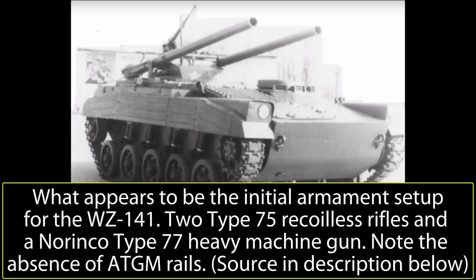A large access hatch with an air intake was present at the front on the right side, in order to allow access to the engine and transmission. Segmented side skirts covered the top of the tracks, with two large headlights present on top at the front and storage boxes covering the rest of the side skirts. The design featured five double road wheels and two return rollers on either side of the chassis. The road wheels were fitted with rubber tires in order to lower noise on the move. The drive sprockets were at the front, while the idlers were at the rear. The tracks were quite narrow given the vehicle's intended off-road mobility, but might have been sufficient given the vehicle's very low weight. It is unclear what type of suspension the vehicle had.